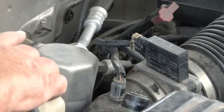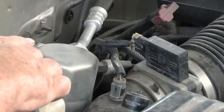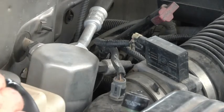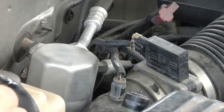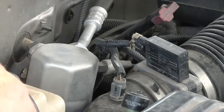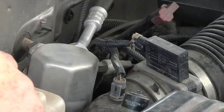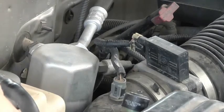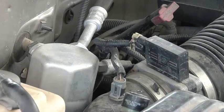After a while, all these fittings get real bad. They just corrode together, and when you try to pull them apart, they just strip out the threads. So I basically got a whole new air conditioning system now, everything except for the evaporator. I'll get the compressor swapped out sometime later this week when my parts come in. But we'll get this video made, and I already recorded the part where I'm looking for leaks, so we can roll that now.